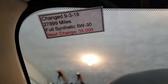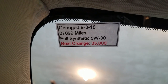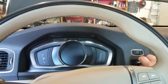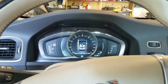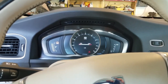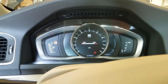I ran the car for about a minute and then let it sit. I even made myself a little label and recorded this in my Volvo manual. I've got my next oil change set to just a little over 7,000 miles out — about 7,101 miles — since I live in Michigan and the winters can be harsh and I prefer to change oil a little more often. We put the key in, hold the start button until the radio comes on, hit OK, go to oil level, and we are in the green. We do not want to overfill it — if it's up at max, you need to drain a little bit out. I think we are done.